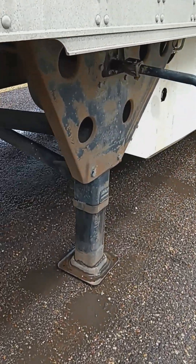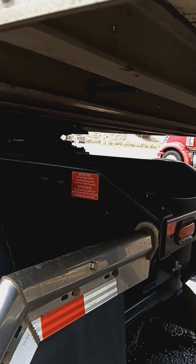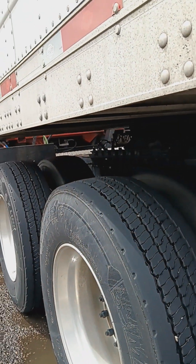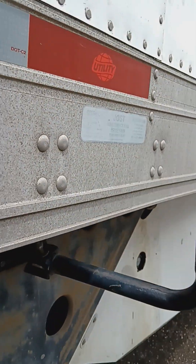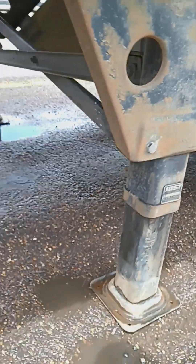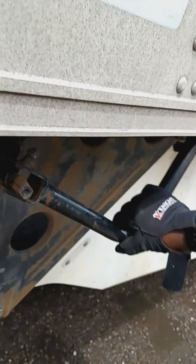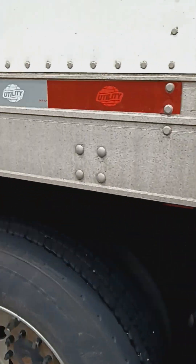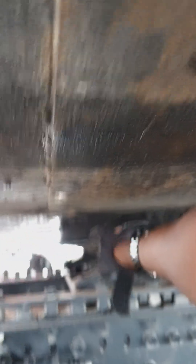What I'm going to do now is fully extend my landing gear to where it'd be easy. We also have a button in there where we can lower the chassis on the truck — that way we can still get out from underneath it. But me being a team player, I'm going about it this way. Now, going underneath here, pull the kingpin handle, release it, unlock the truck and the trailer.